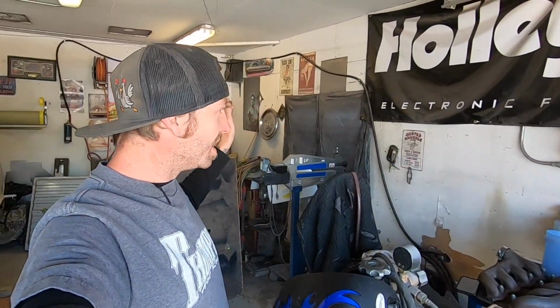I want something that I can just put in there and hum on down the road, not worry about valve train issues. In a race car application, obviously you want much more lift, and there are a bunch of other things you look for in a cam versus what's going in the Twinnebago. But for an application like that, a truck daily driver, a low boost turbo application such as this thing, you're not getting all rowdy, you don't want valve train issues, maybe a good one to look at. Plus, we're going to find out what that thing will actually do once I swap it in and we motor on down the road with the Twinnebago.